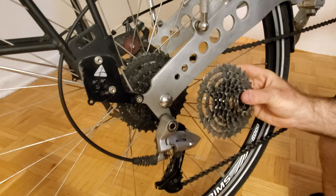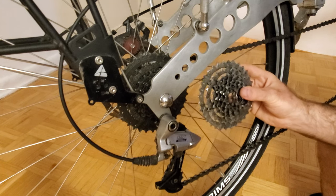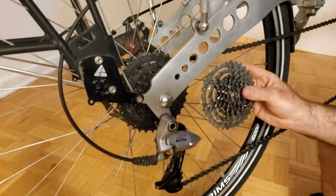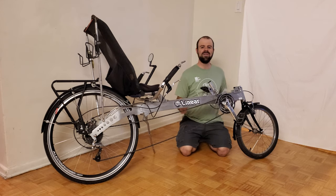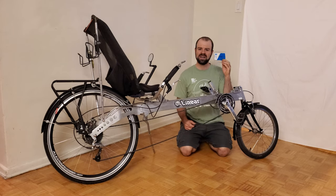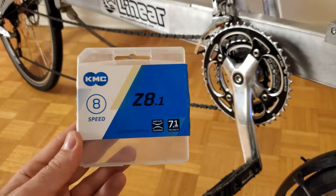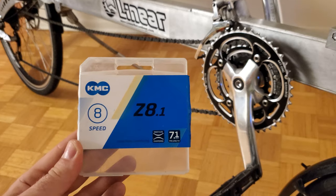This is my existing cassette, and I opted to replace it with one which has an even bigger lowest chainring, once again to help me gear the bike down extra low for when climbing steep hills and carrying a heavy load. At the same time, I also replaced the chain on this bike. A standard bike chain is not long enough to fit on this bike, but I was able to buy two chains and stitch them together, and it worked out to be the exact right length. I felt really lucky that it worked out this way, because if I needed it to be a little bit longer, I would have needed to buy a third chain only to use a few links from it. My only complaint with the new chain has been that it seems to be a lot more noisy than the chain that I had before it.